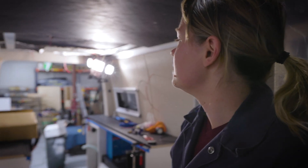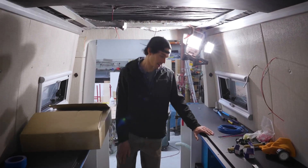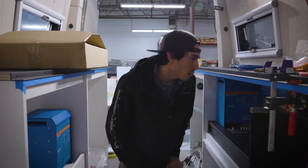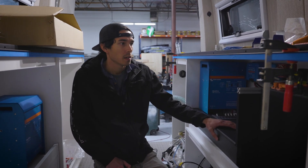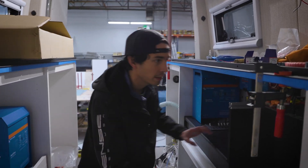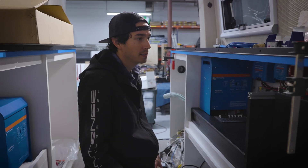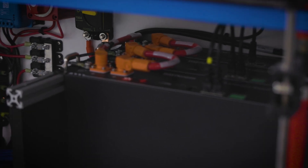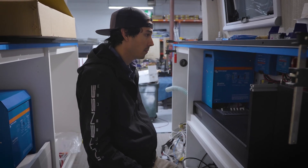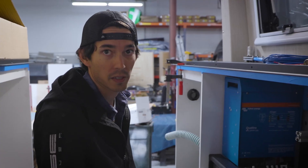Chance, you want to come talk about the electrical? So Hayden just wrapped up this install in here. We're almost ready to turn it on — we're just waiting on our Nations alternator and our WakeSpeed 500 to finish the install. You can see in here we've got three of our 48-volt CAN bus batteries in rack mount style, super clean, really easy to add more. We can fit up to four, which would be just under 10 kilowatt hours of storage. Right now we're at 7.2 kilowatt hours, or about 600 amp hours at 12 volt — a lot of capacity, and with our alternator we're going to be able to recharge those really quick. Zero to 100 percent in about two hours.